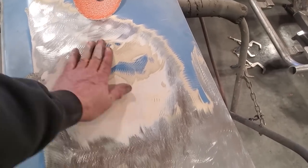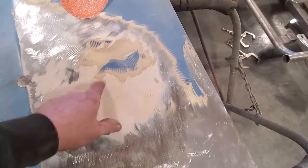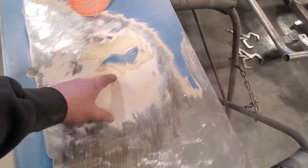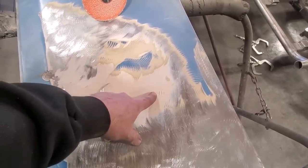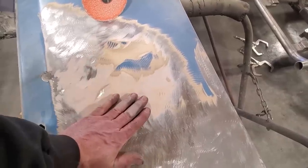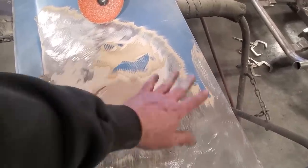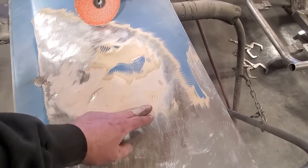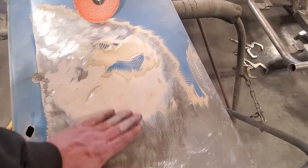And then, of course, you had the old white filler. And you can see the polyester putty right here that they put on it. I never liked mixing two of them together. I always found it was a headache because polyester white filler was very coarse and porous and you couldn't get it smooth enough. And the polyester putty was really, really fine. But the two of them had different sanding characteristics. If you put one over the top of the other and then sanded and broke through, you'd sand the filler quicker than you would sand the polyester. And you'd always end up with waves all over the place when you start mixing the two fillers together. So it was either use one or the other. And if you were going to use it, it was all right to use it for a top skim coat. But if you cut through it, you're going to have waves.